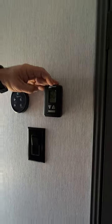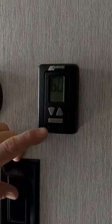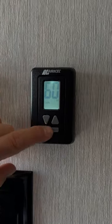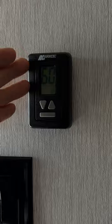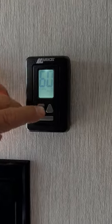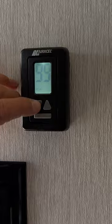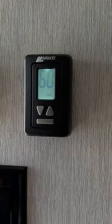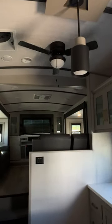This thermostat controls the front air conditioner and the furnace. There's some button pushing when you first turn it on. You've got fan low and fan high — that's just the AC fan. Cool high and cool low run the air conditioner continuously regardless of thermostat setting. Cool low auto and cool high auto will cycle on and off to your desired temperature. Then you've got heat. I like to make sure we burn it off first, so I'll turn it down to about 72 degrees. The latch option is off. This other switch controls the ceiling fan.